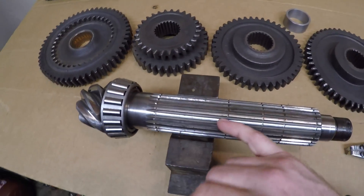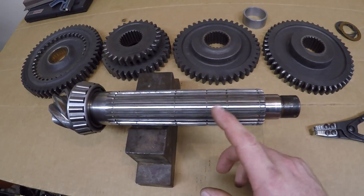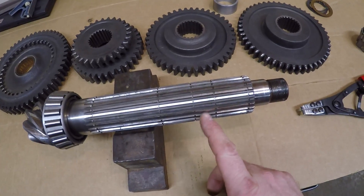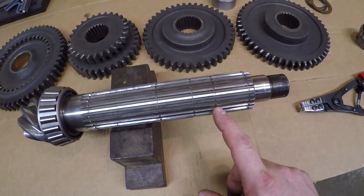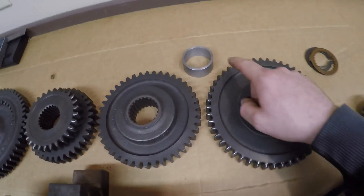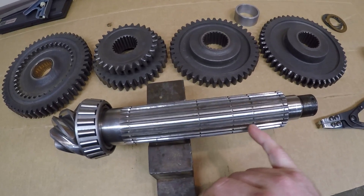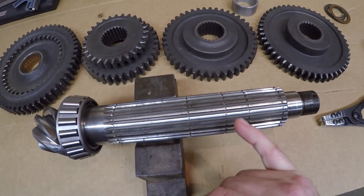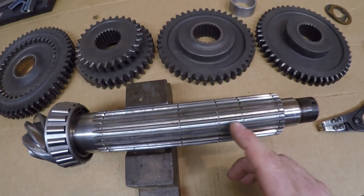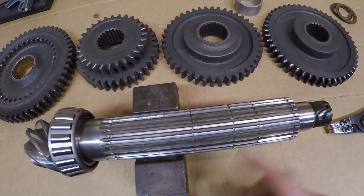Before the assembly begins, I'll give you one last brief rundown. You're all familiar with this pinion shaft — it is the production version because the prototype one was destroyed beyond repair. Main difference again: the prototype shaft did not have this snap ring groove here. That is why it utilized the spacer to go between these two gears. Just make note of that for now. I don't know if that's going to cause me some issues when I go to put the upper sliding gear shaft in in the next video, but just keep that in the back of your mind. We might be revisiting that once again.